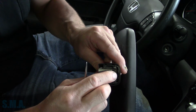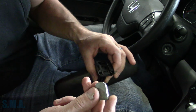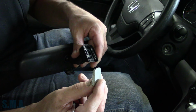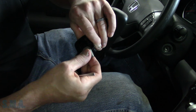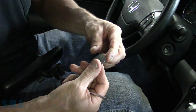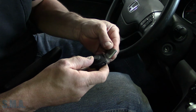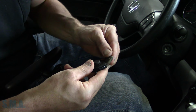So then the button comes out like so. We'll slip that right out. The thing you have to be mindful of is what's top, what's bottom, what's inside, outside, because when we glue this on the windshield, if you do it wrong, you ain't getting it back off. So make sure you note the top, you note the bottom, and then clean this off. So my suggestion would be to take a Sharpie and write top and then draw an arrow, or just remember and live your life and take chances like you do with this razor blade gliding at your thumb.